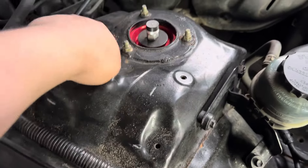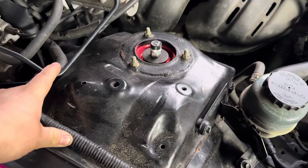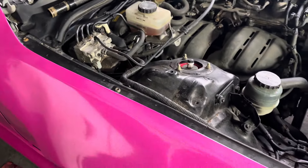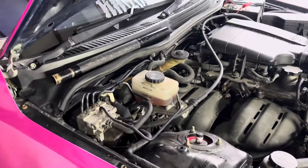Some people might argue that's a lot of area to take out the strut tower, but we'll weld up these two seams and once it's on the ground and we know kind of where it is, we'll make up a wee kind of dome plate over where it needs to go. Not sure what I'm going to do about the back edge though — I might need to do that from underneath because I don't really want to take this off and re-bleed the whole system. Could be doing with a wee bit of fluid in it anyway, that's a bit low. I'll get the tripod out and time-lapse the cutting because it took a lot longer than I thought on that side.